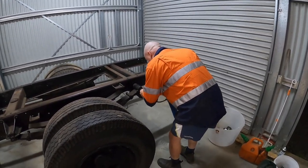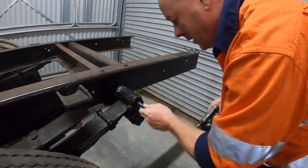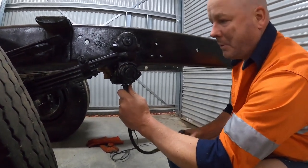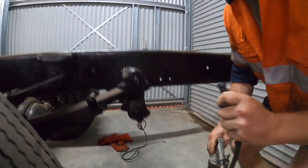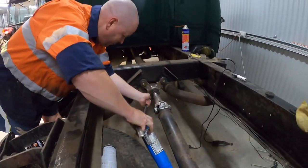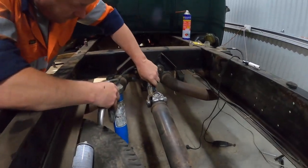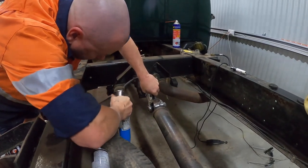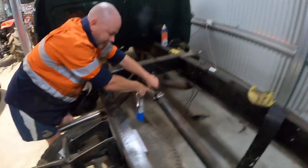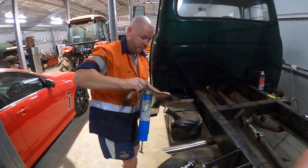These hangers were done recently but we'll top them up. Connect your hose on - you'll know when there's enough grease in there when you see it start coming over the top. That one's done. Going underneath, you can see on the left hand side - yep, that one's done too, with plenty of grease coming out on the other side of the hanger. That one's full. And that one's starting to come through - you can see it in the gap of the universal joint. She's coming through.